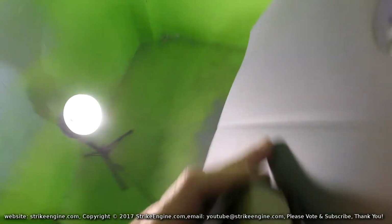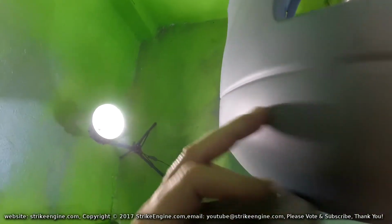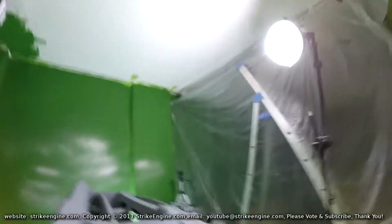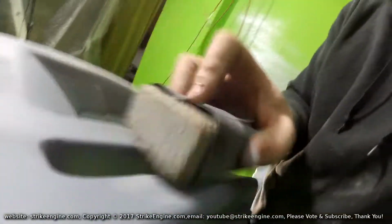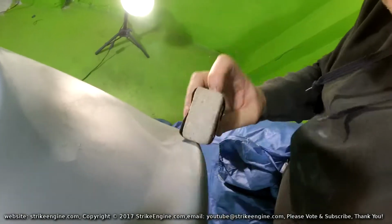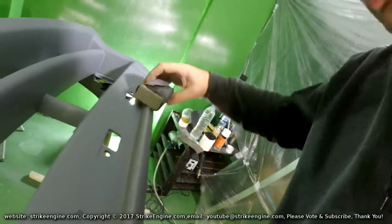Because the area is quite large where we need to sand down, I'm going to use a sanding block for sure. I don't want any extra grooves in this. Come round to this side where we've got this big lip here. Just get the 240 on it. Again, just with the edge of the block, circular motion. And come back to you when it's finished.